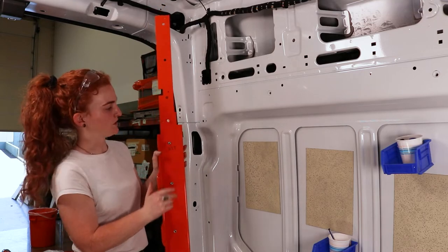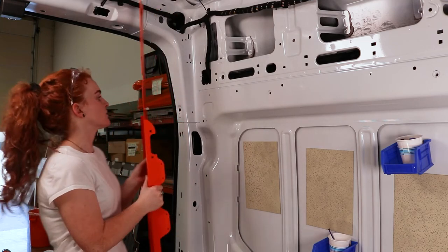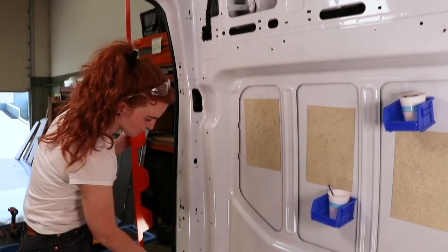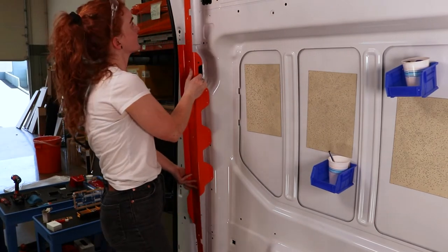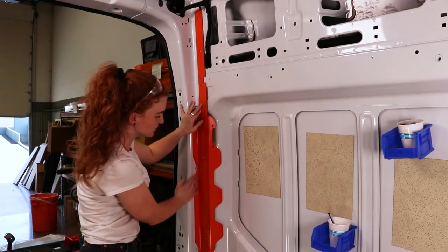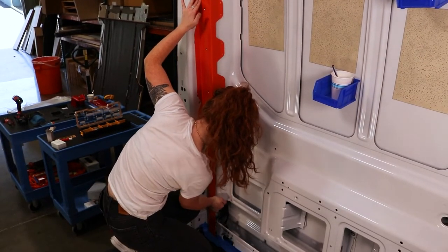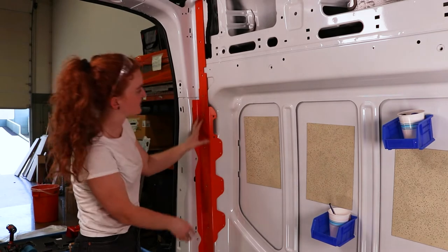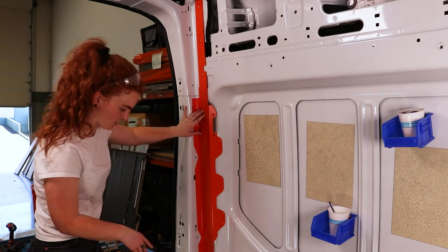TX 1.2 also has indexing points on the back to slot into factory holes — one at the top and one toward the bottom. On the van, there's one near the top horizontal support and one way toward the bottom. I'm going to slot this into those holes — you might have to move your wiring up here a little bit. It will sit really tight up against this back pillar. Once that's in place it holds itself pretty tight, but I'm still going to set a couple of set screws to keep anything from moving while I'm drilling out my holes.